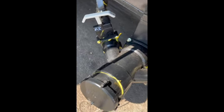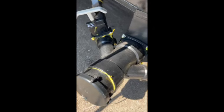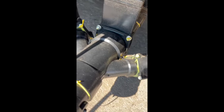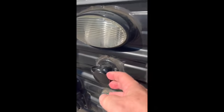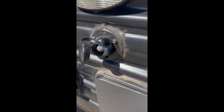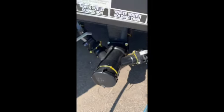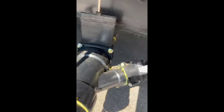One thing we forgot: the sewer connections. The big pipe is black water, and the smaller ones are gray. Gray is shower and dish water; black is from the toilet. When draining, pull up the black one first. When the black is done, follow up with the gray. As a tip: run a hose in and flush it out with all the valves open. Always remember: black first, then gray.